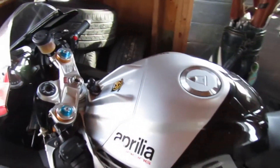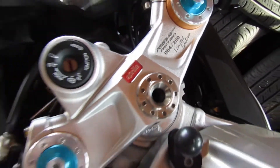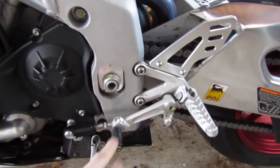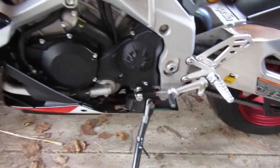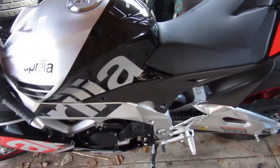Well, that's not the bike we're working on. The one we're working on is my Aprilia RSV4 RF. We're going to be installing a GP shift lever on it. Love seeing that — limited edition, beautiful. We're going to be putting on a whole new shift lever, a GP shift swap, so it'll be 1 up, 5 down rather than 1 down, 5 up. So let's get to it.